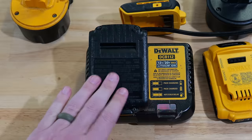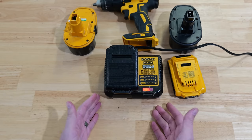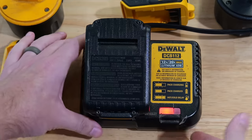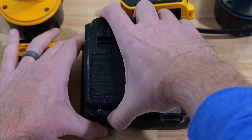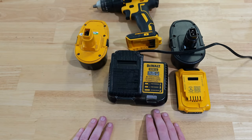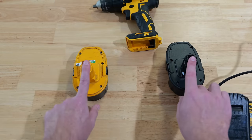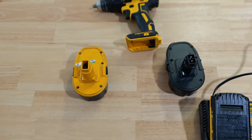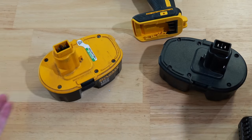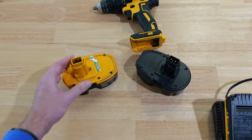The thing with these lithium batteries is that when they get completely depleted, the charging device doesn't register that a battery is inserted. We just need to get a slight charge into the dead battery so the charger recognizes it needs to be charged — and it does not take very long. Then we remove the wires, put our battery charger in the middle, and the dead battery is now taking a charge.